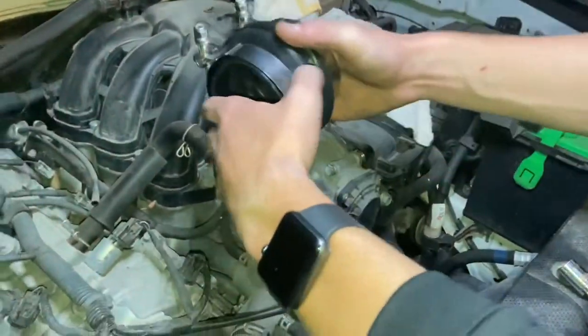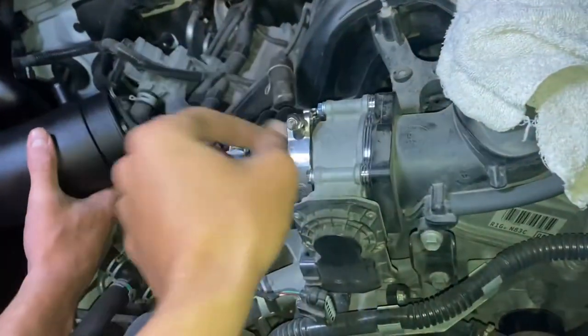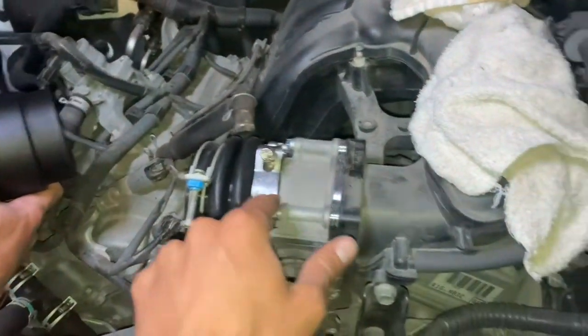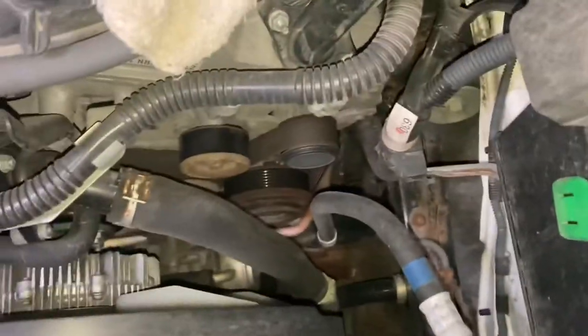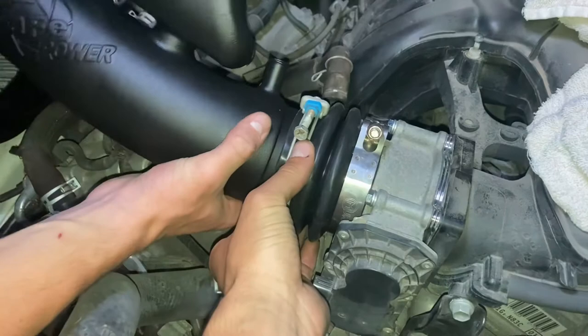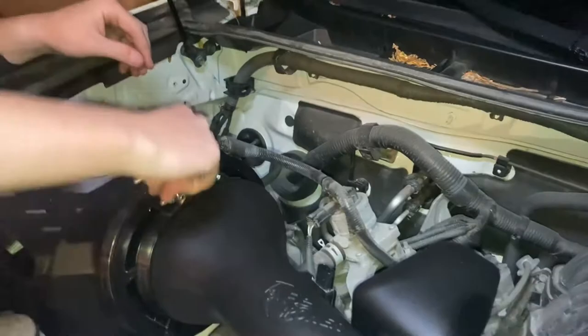The lettering on the coupler is going to be away from the throttle body, so the smaller clamp goes on that end. To get the rubber coupler on, I took off the bolt completely, disassembled it, put the rubber on without the clamp so I could get it all the way around and nicely secure, then put the clamp on and screwed it down. The reason the clamp is different is that someone dropped the nut into the hood somewhere, so we have to buy another one — but it's 9 o'clock, so we'll do it tomorrow. Using the stock clamp for now.